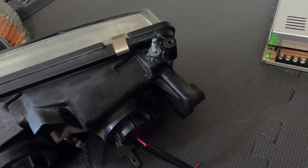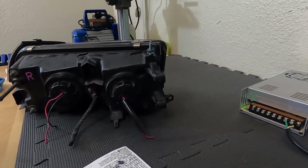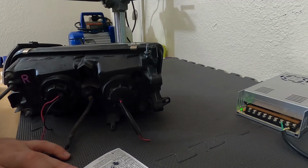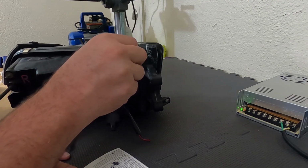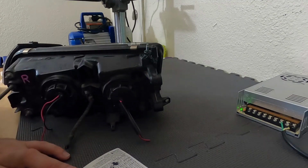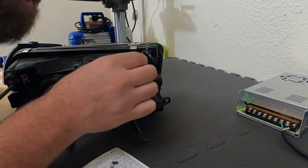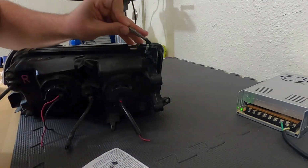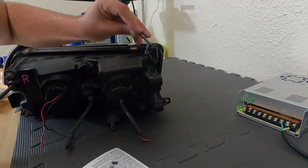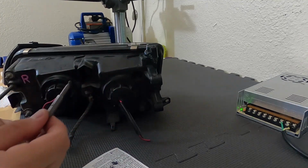That is anchored. I did line it up with the corner, and it's perfectly in the center of the alignment hole. The stud's a little bit smaller than the factory one, I think, but I think it'll be good enough. And then I'm just gonna fill in around that. Try to get up to the threads a little bit so that it anchors itself in there. I think once this all dries, you won't even be able to tell other than the stud sticking out. It should get pretty black like the normal plastic in there. And it's not going to use a nut or anything to hold it in place, just the bolt to the right of it. Yeah, I think that's going to do good.